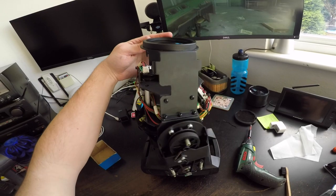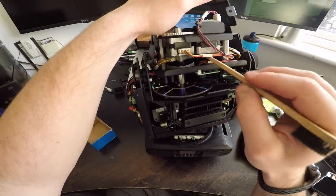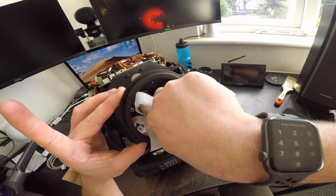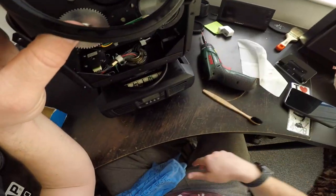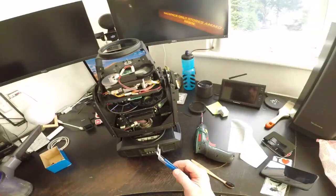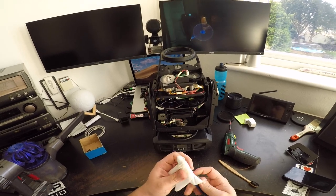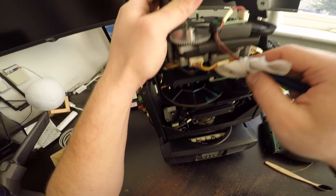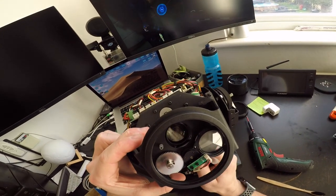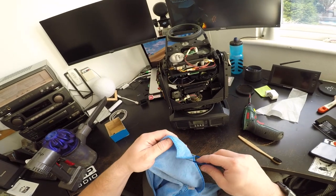Now the focusing lens. I need to clean it underneath and on top. The top part is easy because I can have access to it. But with the bottom section, I have these tweezers and I can strap a cloth around the tweezers like so and shove them in here. See how much dirt came from this lens — it's impressive. Wet the lens with this and then do the same with the cloth.